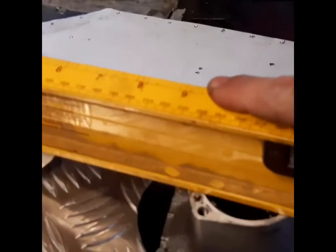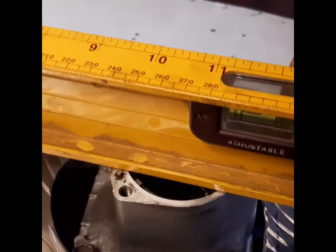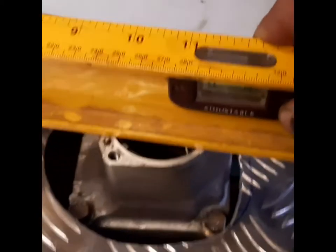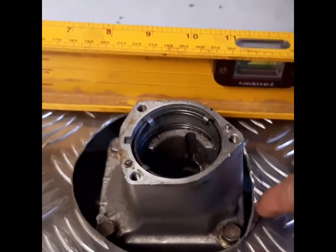I was concerned whether it would actually be touching the chassis. You can see it isn't at the moment — it's a function of how high up the gearbox is sitting. The obvious thing to do is to put a spirit level on the top of the gearbox and check that it is level. It isn't quite level — it actually needs to come up very slightly further. I think I'll need to relieve a little bit more of the panel just here. And the concern I had about clearance between here and here — obviously there isn't a problem. I wouldn't easily get my finger in there, so that should be fine.